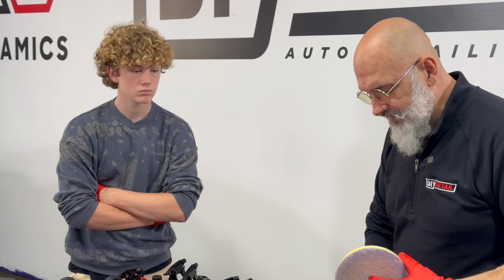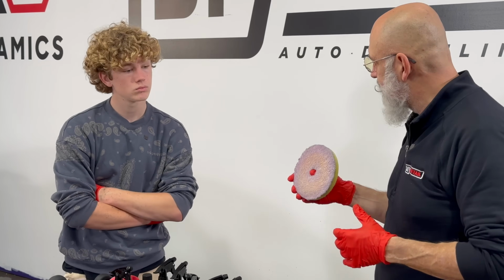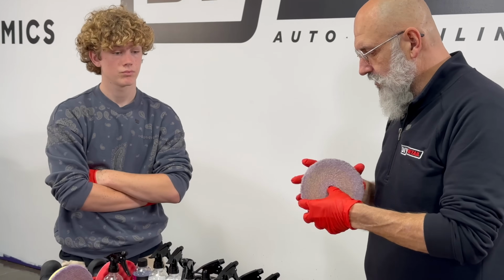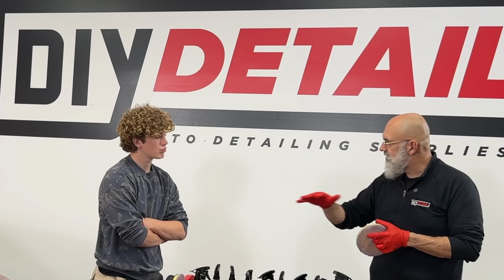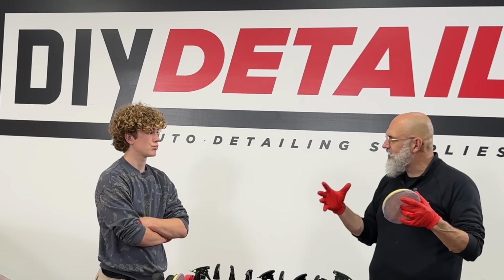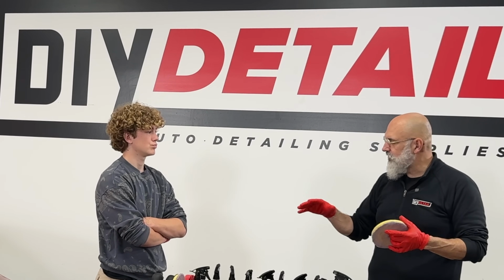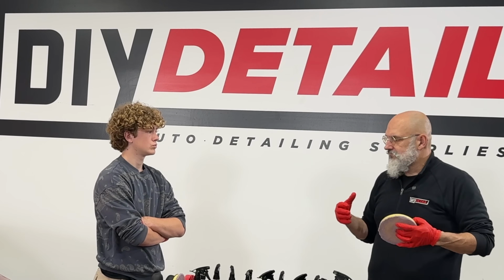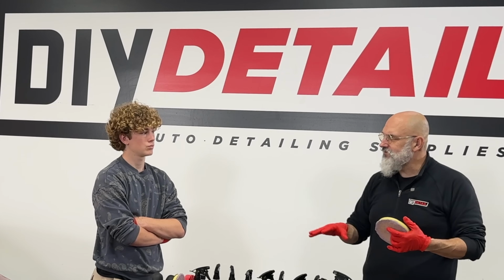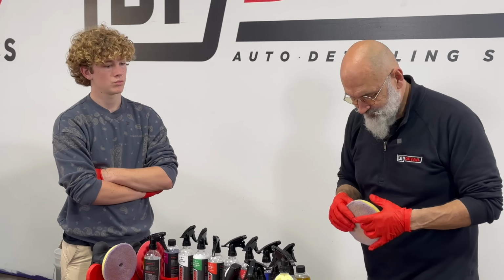Finally, we have our wool pad. Now, the wool is our most aggressive pad, and if you feel it, it's quite harder. And this aggression means we're removing the clear coat off the vehicle. Not all at once, but we're removing a little bit of clear coat every pass that we do. So we don't want to go heavy with it. And in your case, we don't want to use this pad because we want to leave as much clear coat as we can on that hood.